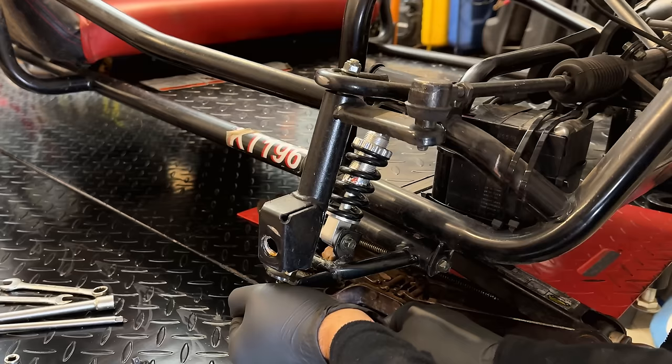And we want the engine to crank when this is up, which will be the bottom tab right there. This is the wire that's going to go to the start solenoid. So that'll go right like that. That should be it. We just need to fit this in, tidy up the wires up front, then we can move to the back.